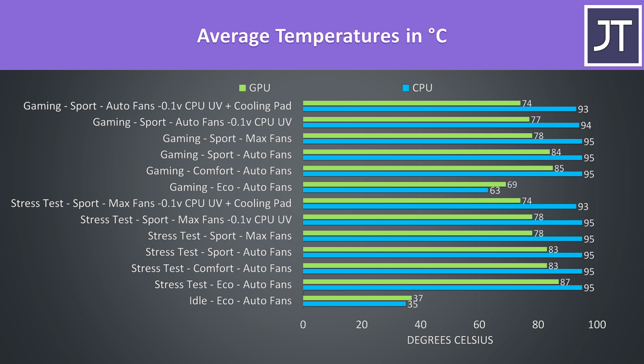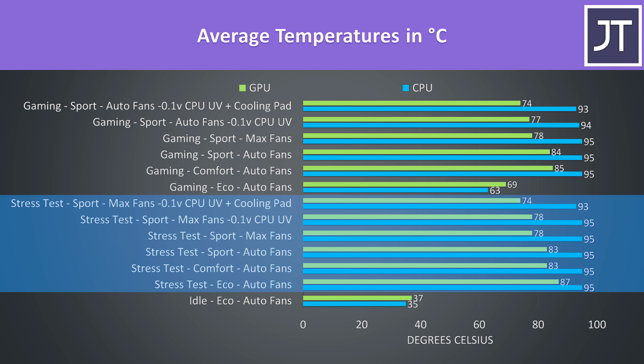Thermal testing was completed in an ambient room temperature of 21 degrees Celsius, so expect different results in different environments. It was actually quite cool at idle given the specs. Worst case stress tests were done with the Aida64 CPU stress test with CPU only checked, and the Heaven benchmark at max settings at the same time.